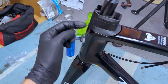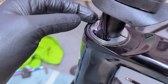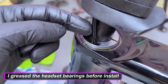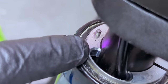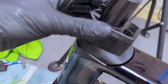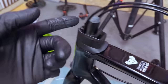Let me show you the cable routing inside here. You can see this aluminium compression ring — it's really nicely machined — it helps preload the front bearing. The hose for the front brake and the one around the other side is the rear brake, and this all slots together nicely with chamfered edges. The headset spacers are glass-fibre reinforced plastic. Everything up the front slots together nicely, so now I can route these cables through the handlebars and fit the shifters.